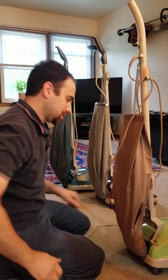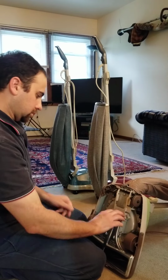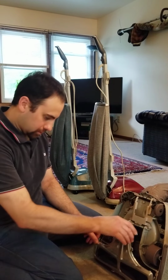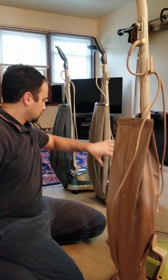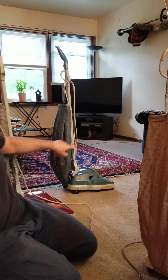For control purposes, this is one you might say is all original. So this is convertible 1020 with black bristles as it would have come with, and a beater bar. And this is the older style metal based machine, 420 watt for carpets, and it goes into high speed mode when you put the attachments in there, which brings it up to 625 watts. So 420 watt on flooring, 625 attachments, 6.5 amp, 6.5 amp. Now I have purposely positioned us in view of the Oriental rug.